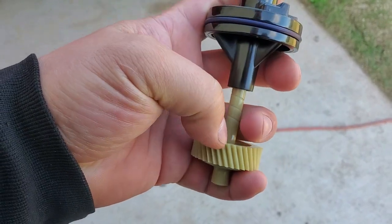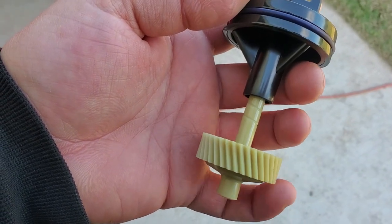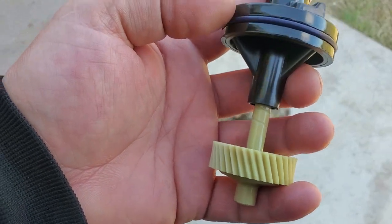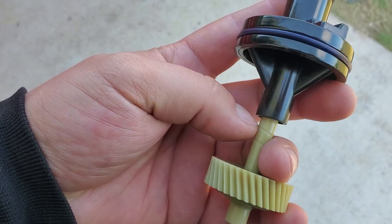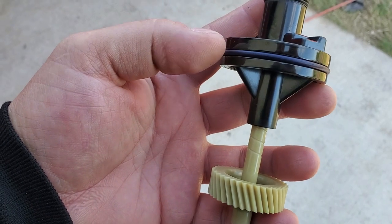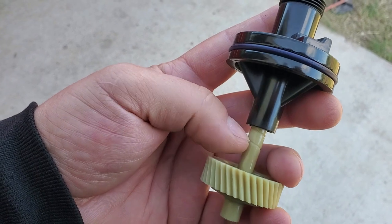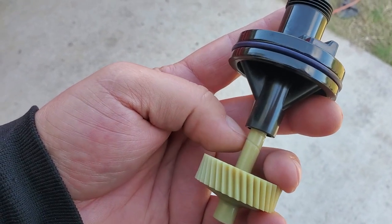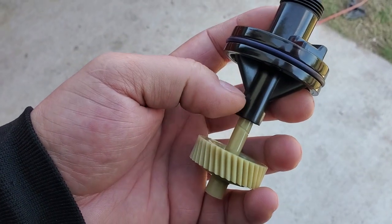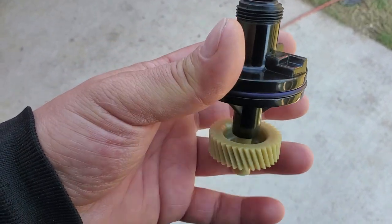The way this seals — obviously there's some wobble — which would allow oil to travel up through this hole. You see the lines on the speedometer gear shaft? These lines are tapered and go down in a screw manner. What this is designed to do is drive the oil that goes in here back down into the transmission to prevent leakage.